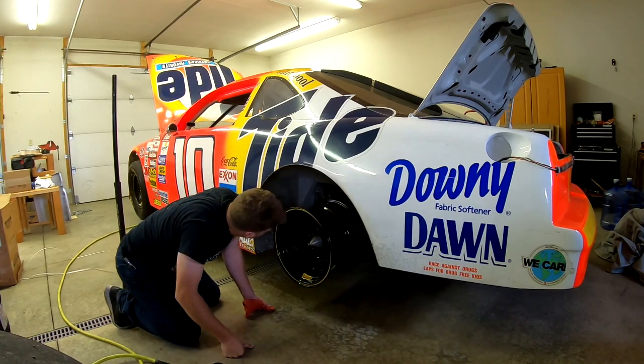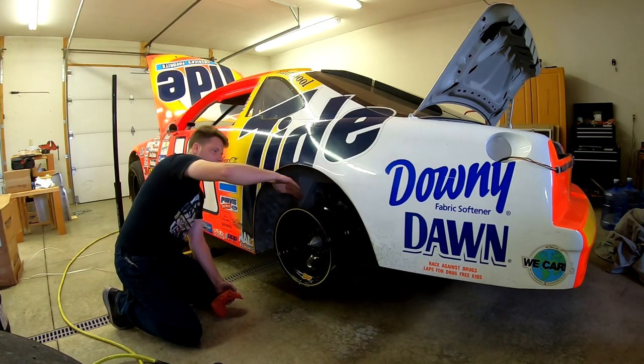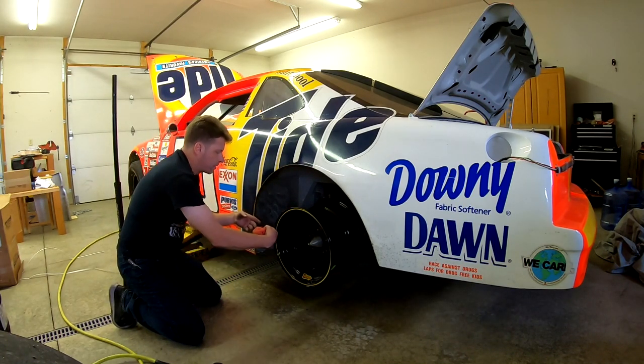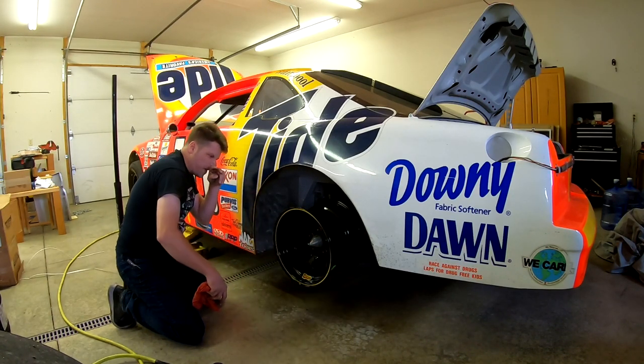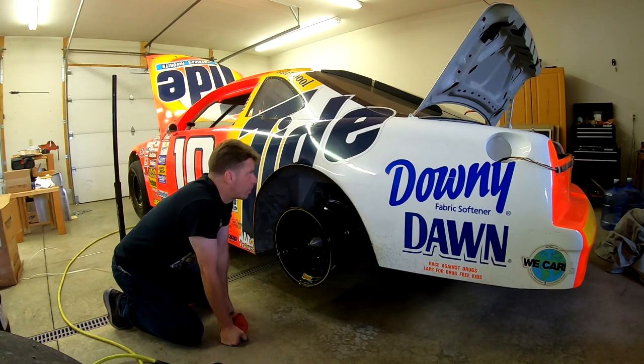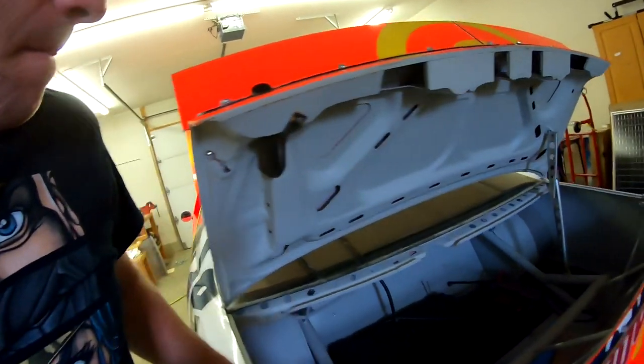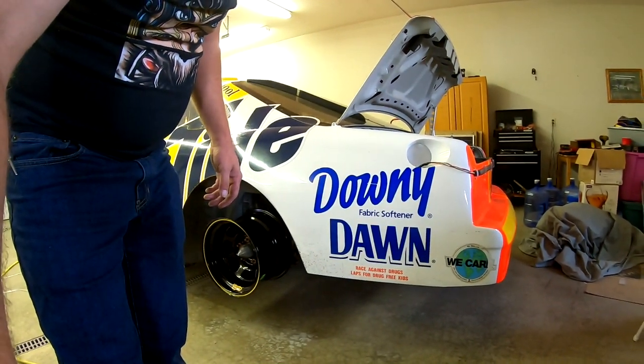This has even more clearance than the front; the brakes are not as big, so it looks good here too. Although the rim of the wheel looks completely flush with the bodywork, the suspension is so stiff that I don't think I'll ever have a problem with rubbing. There's the fuel line up in there — I think that's a little loose; maybe it should be more secure. There's an AN fitting in there on the other side of that pipe. Let's get this wheel put back on.